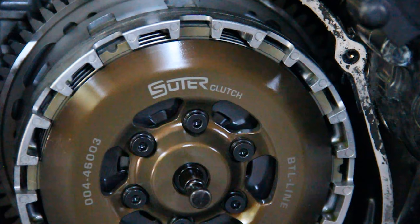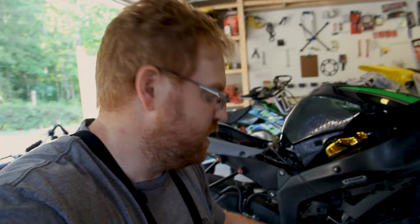You're thinking, 'Oh my gosh, I have to repack my clutch, I have to buy an entirely new clutch every single time.' No, you don't. What you need to do is simply swap out steels. The steels are just a metal part that has a measurement — these don't really wear out in a race weekend; they'll probably last as long as I keep this bike. I did go out and buy an entirely new clutch pack because you should do that anyway. Buy an entire new friction set, and then I purchased extra steels with different measurements. Kawasaki does this already — they have 2.6mm, 2.3mm steels.